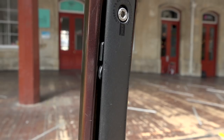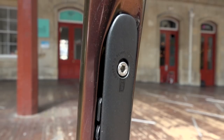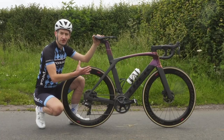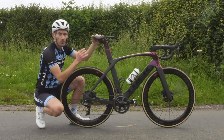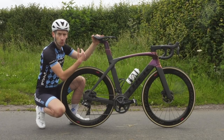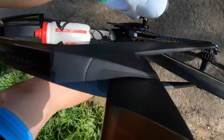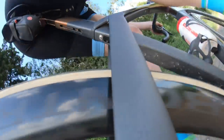There's a little slider, and you basically undo a couple of bolts, move that slider and choose whether you're in a firm setting or the softest setting — the idea being that you can simply tune the compliance to suit your needs. If you're riding a very smooth circuit you'll have it in the firmest setting, and on rough roads you'd use the softest setting for a bit more comfort. There's also a new rubber bumper stop at the back which provides a bit of rebound damping just to control the movement, so it's not going to flex wildly out of control. It's also integrated into the top tube — the previous Madone had it in the seat tube, but having it in the top tube provides a cleaner look and just a bit more aero than the previous design.